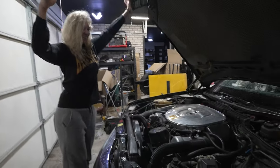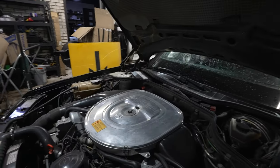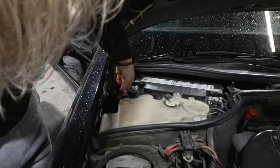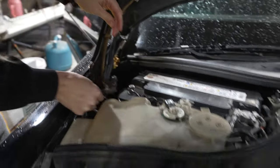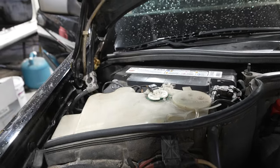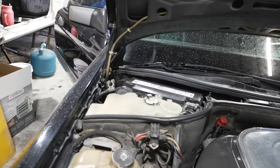The battery is over there. You might be able to just pull one of the terminals off — that's positive, that's negative. Pull the negative off, get it away from the battery, make sure it's not touching metal. Make sure you disconnect your battery before you start doing this stuff — you don't want to short something out.